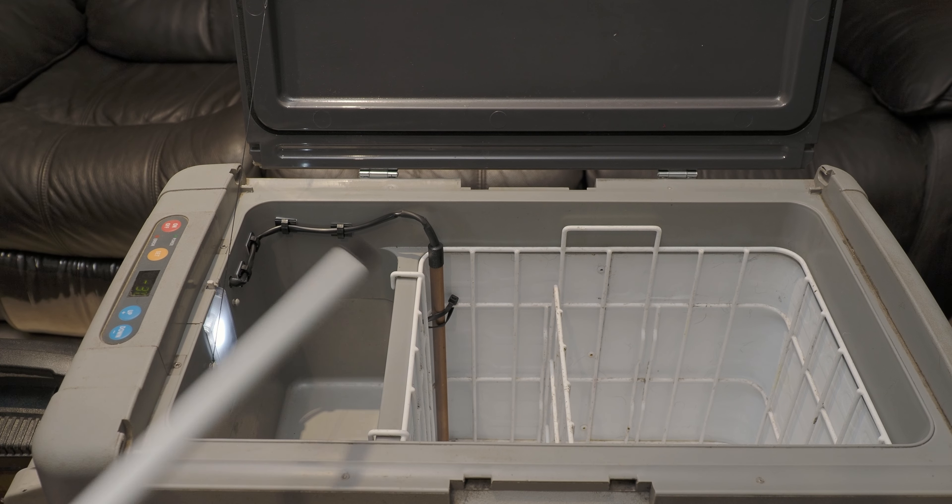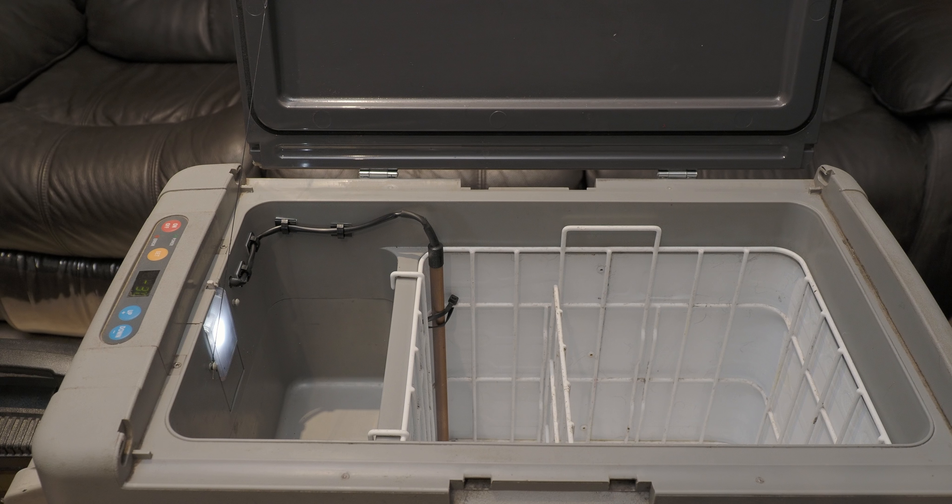It has taken a little bit of room from the side with the cable, but that's minuscule. The one issue I've found is that I put a rubber bung on the bottom of the copper tube to stop moisture getting in, and I think that's altering the temperature reading slightly. I've got the fridge set to minus three, so the internal temperature is one degree, which is what I'd normally run it at. A metal plug might have given a more accurate reading, but I used a temperature probe to measure the actual internal temperature while adjusting the control panel setting until I got one degree.